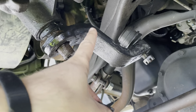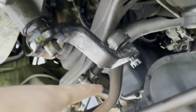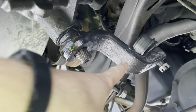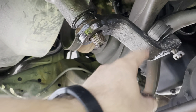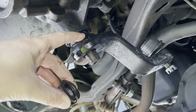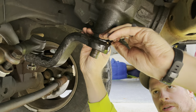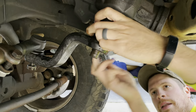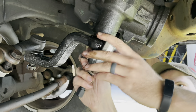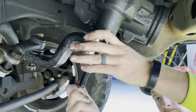The way I usually do these is pull the pitman arm off on this end of the drag link, then pull the steering box, and just leave the pitman arm on there, cut it off right here so that I can mail it back for a core charge. But with it being this wet, we might be able to get this thing off. That is well lubricated — it's been sitting leaking like this for probably a month. Looks like we weren't totally out of power steering fluid.